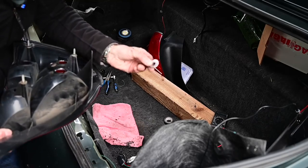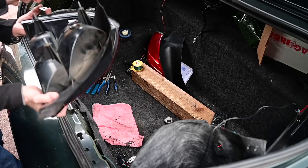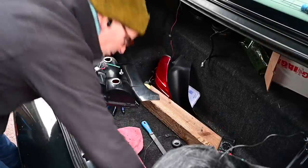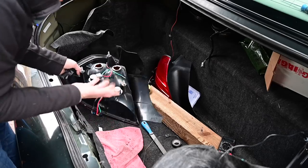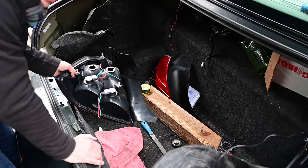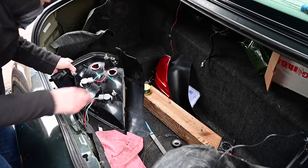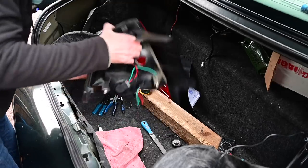Good news: proof that it's reflective on the inside even though there are no lights mounted in it. I wish Ford had divided it into two pieces - that would be much more useful. With a file I've managed to cut or file edges into it so I can put the holder in, rotate it, and lock it in place. I've realised I only ordered two of these bulb holders, so I'll do all the prep and order two more to get them soldered in later. It should pass the MOT with just one either side, but it'd be nice to have the complete complement.